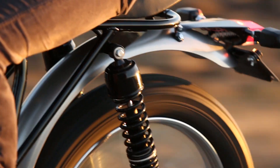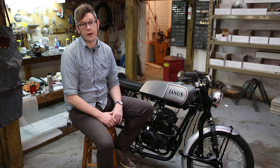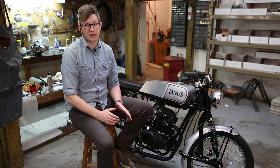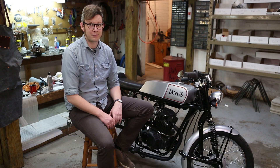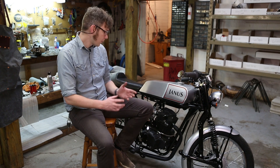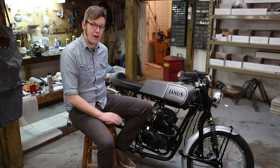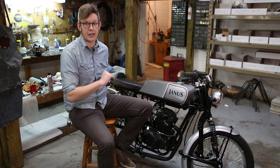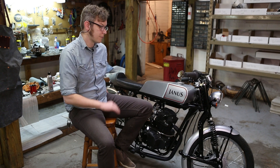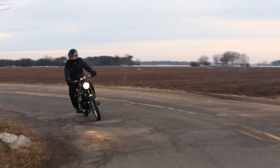When we first started testing the bike, we had a heavier rear shock absorber on the bike and we noticed that it was a little jarring. So we've lightened it up. This bike is probably lighter than most motorcycles on the road, and we've lightened the shock up even more — it's just softened everything up. Even the front suspension has benefited from the lighter spring in the back. When you're riding on the road, it's a really comfortable position; it sort of just floats as you're riding.